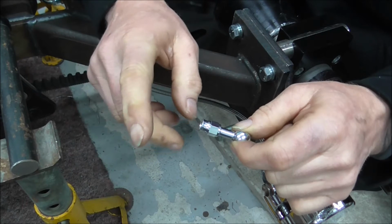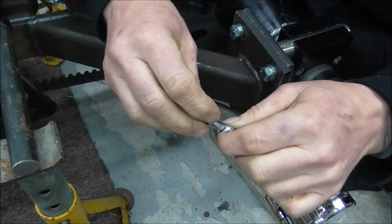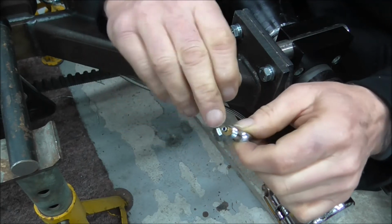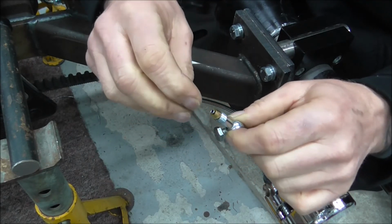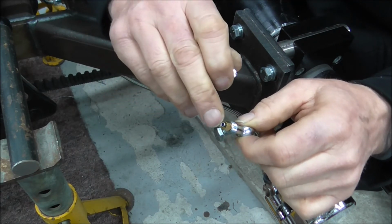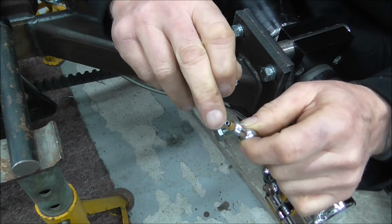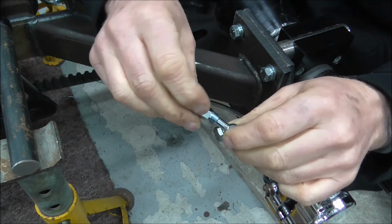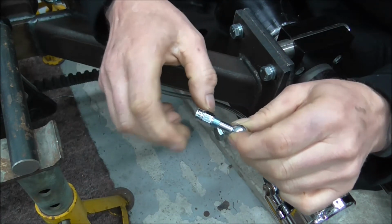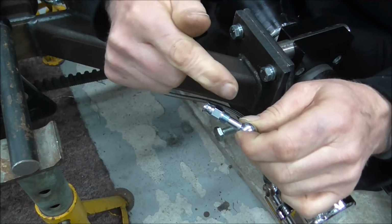I tell a lie, I did have a leak once, and that's when I learnt the lesson of making sure, and it was on a car, not a bike, that you never get your braid inside that olive. Because when we took it to bits and looked, I'd actually got, believe it or not, a single strand of the braid had gone inside when I put the olive on, and that's what caused it to leak. And that's why I was stressing to you, make sure that there's not any of that braiding inside that olive.